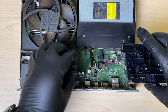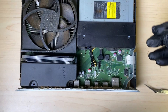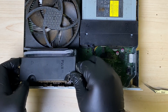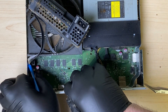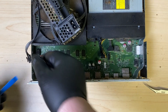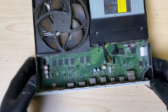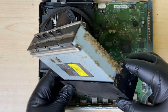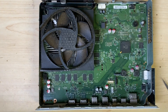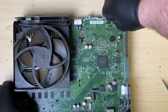Let's go ahead and take out the hard drive. Two connectors here, you can pull up on them. Set that aside. Power supply — it's always a little awkward to detach with this clip over here. Set that aside. Disconnect the disk drive. A little bracket here we'll pull off.